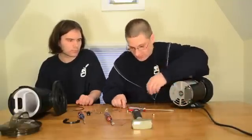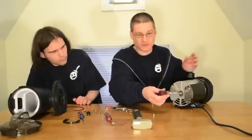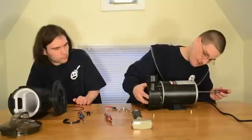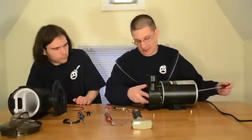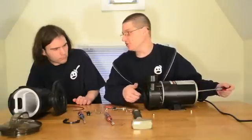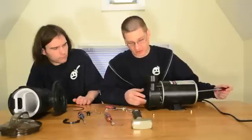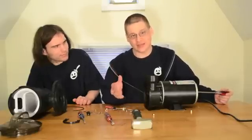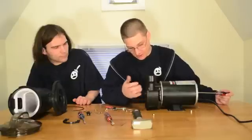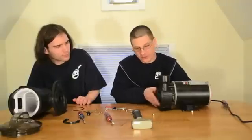There's a little cap on the back of your pump. Pop it out with a small flathead screwdriver, and you'll see a groove where you can stick a big screwdriver to hold the shaft. With your other hand, grab the impeller and spin it to unscrew it. This impeller came off easily, but a lot of times they get stuck — there'll be another video showing how to remove stubborn impellers.